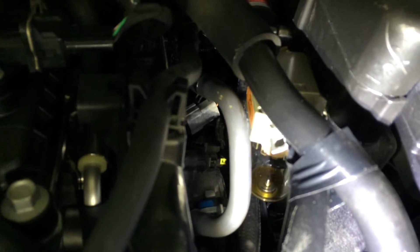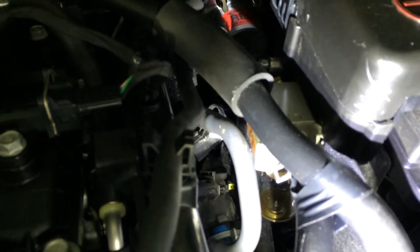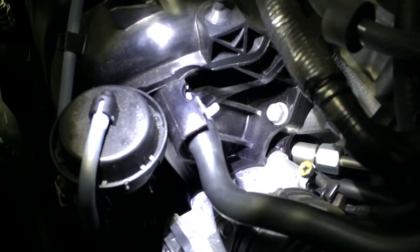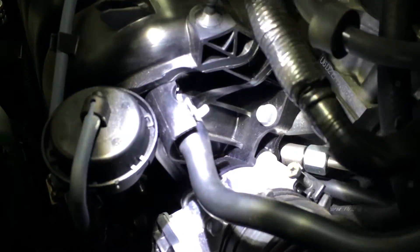By the way, this car has only done 1800 K since new so it's probably not fully bedded in yet. Then the exit pipe — I've used the original pipe that exits from the top of the rocker cover here down to the side of the inlet manifold. You can see it just there and that attaches to the exit of the catch can.